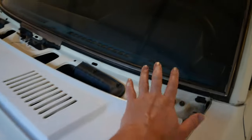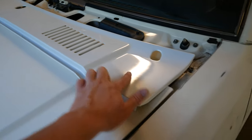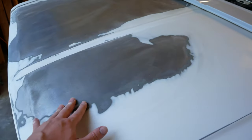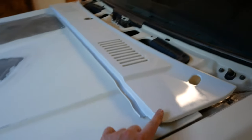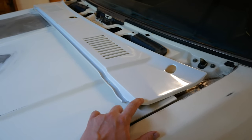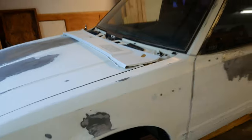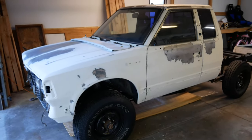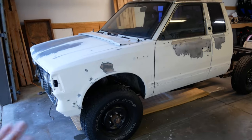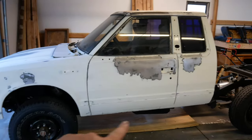I took this front top panel off into work and as you can see it's crazy shiny — fully prepped, though not buffed, just a test spray in basically the same condition as the rest of the truck: some bare metal, some of this paint. We're going to see if this can withstand being wrapped — the heat and the pliability of pulling the vinyl on and off over and over. I'm going to put this to its paces with some test vinyl. If it's wrappable, that means the whole truck needs to be sprayed at a mildly professional stage-one paint level, and at that point I might just paint the truck instead of wrapping it, because that piece looks really good now.